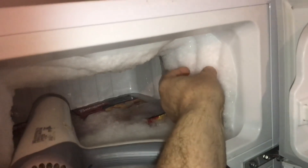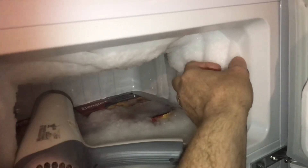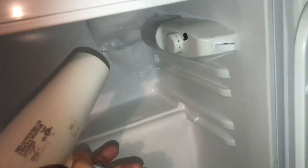We can see a lot of water builds up. You want to let the ice melt — you don't want to chip this off or you'll damage stuff. We'll also put some heat on the ice in the refrigerator and start to peel back some of this ice.